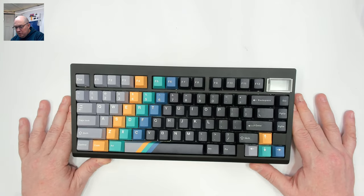They're on there pretty tight, and you don't want to pull off the keyboard top until you have disengaged all the clips, or you could actually end up breaking one. All right, so get under here. You want to just gently go and push the clips naturally off. I'm still engaged over on this side. One more. There we go. All right. And that's how the top comes off.